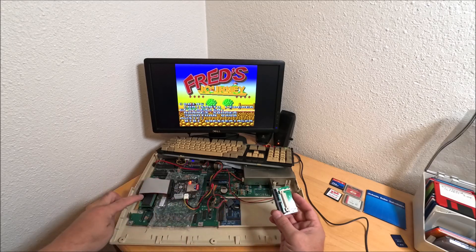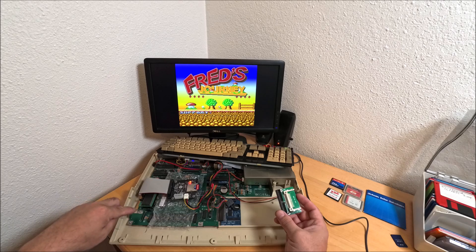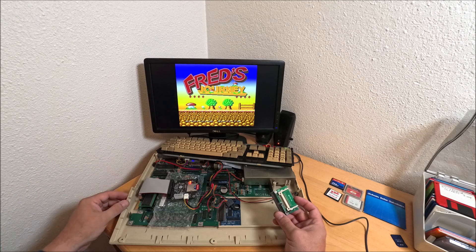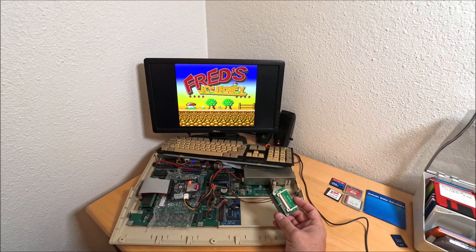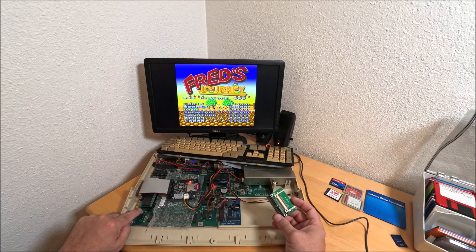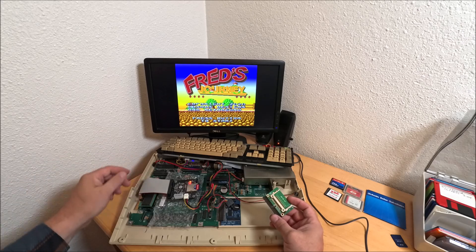You can get just the adapter itself, then you can add an extended adapter socket for Amiga 500. It's not a board relocator like you can get with some other IDE interfaces or with accelerators like Terrible Fire when you buy from other places - those come with a relocator. This is just an extra socket - a 68000 processor socket. You just put it in and then you put it in the adapter, otherwise it will not connect properly.